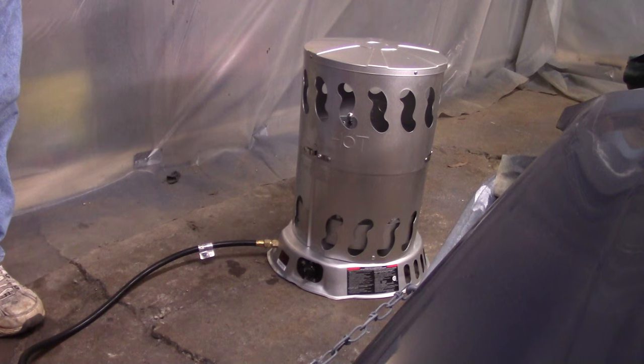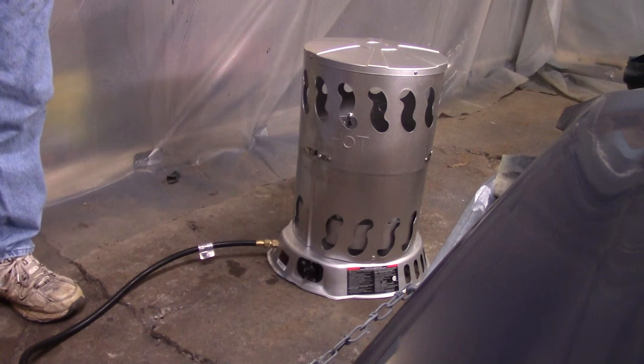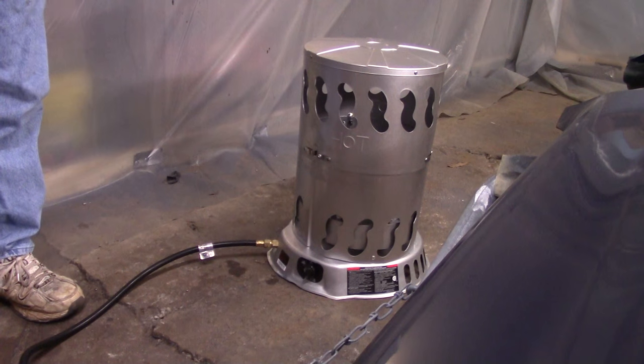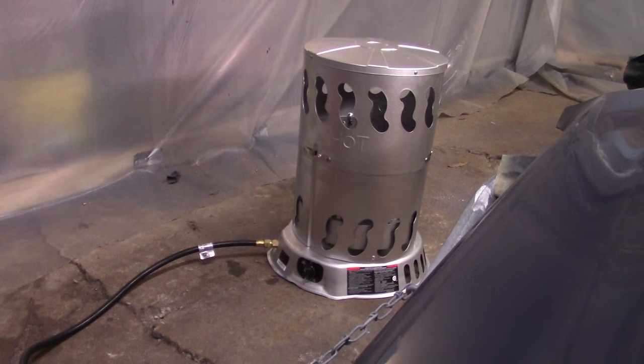I believe it's gonna be that piece in the gas valve — the little solenoid. I should have took it out and showed y'all what it looks like. It's basically a little electric solenoid that pulls a plunger in. When you push the button it pushes past the solenoid plunger, and as soon as you turn it loose, boom, it goes out. I guess I'll be calling customer no-service and seeing if they'll send me a gas valve.